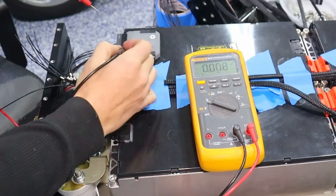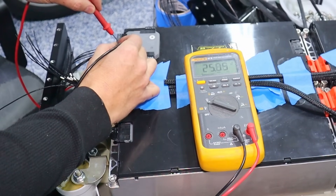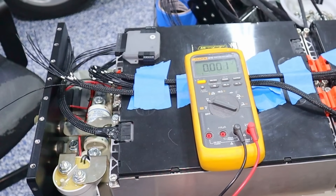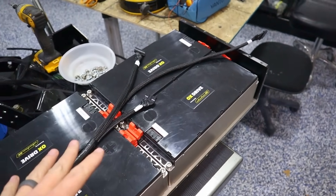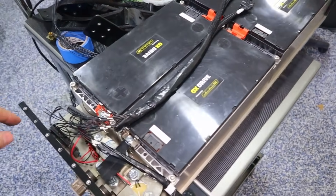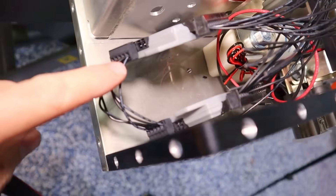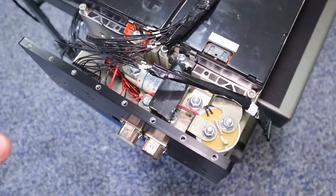Just doing a quick check here — it looks like we got all the wiring figured out. I've got the wiring looms all made up. There are some pins we weren't using in the connectors — I just unplugged them and wrapped them so they're not live, but if we want to plug them back in in the future, that's easy enough. I do need to order some more pins; there's a two-slot connector that we just don't have any for, and I think I need four of them for all the thermistors. We got a lot done on the MGA — we were able to take out both battery boxes, re-situate the motor in a better position, and even got into some of the wiring of the battery boxes. Thanks for watching — see you next time.